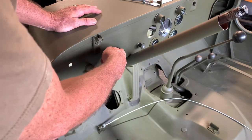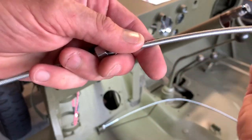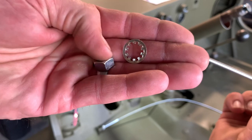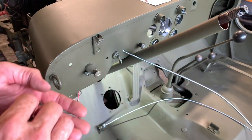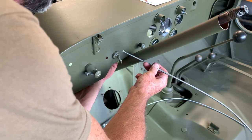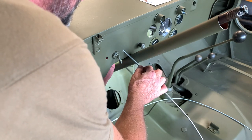We're going to do the throttle cable first. I'm going to remove the nut and the lock washer — they just slide right off. Keep them in your hand, because when we put these back on, the lock washer is going to go on the inside of the dash, and then the nut goes on the back so it tightens the lock washer and bites onto the back side. Slip just the front end of this cable inside, then reach underneath the dash. Lock washer goes on first, then the nut itself. Leave those hanging there for a second because we're going to have to crawl underneath the dash and feed that cable through the grommet hole in the firewall.